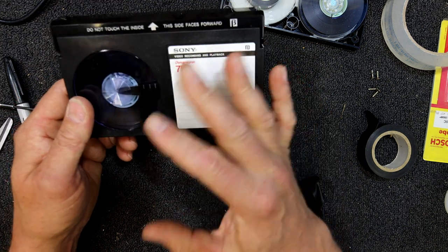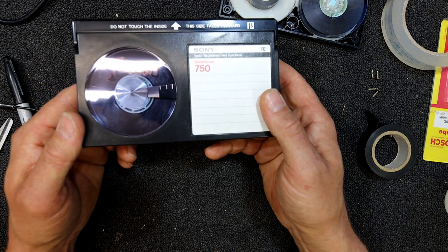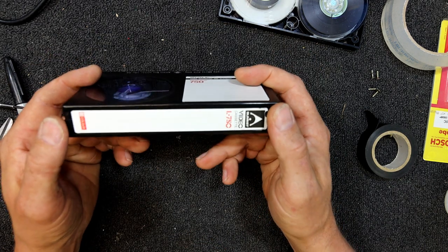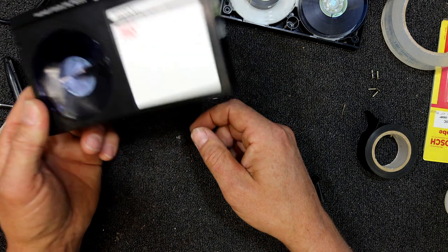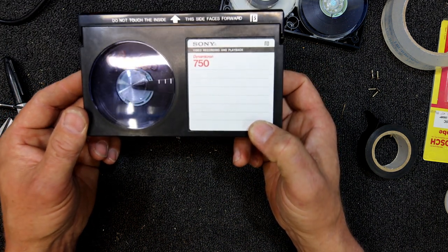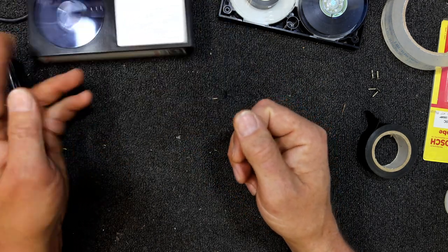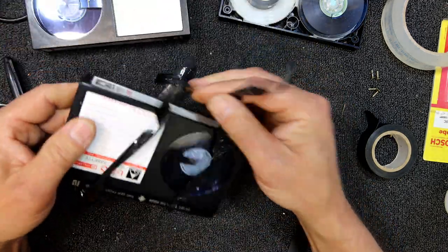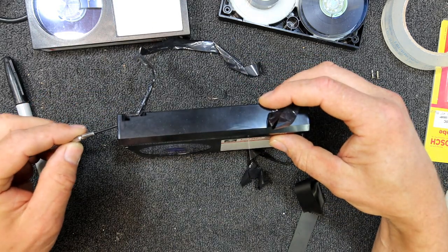The other thing I'll do is write 'spliced' on this tape so I know to basically toss it in the bin once I've had a look at it and seen what's on it. Ideally you would start the tape just to one side of where the joint is — wind it onto the take-up side. That way you can play all of it without the joint even touching the video heads, right to the end of the tape. Then rewind it, and as long as we stop it just before the counter hits zero again, there's no need for it to touch the video heads at all.